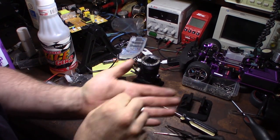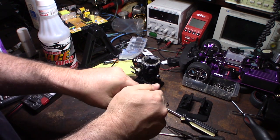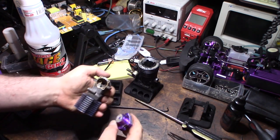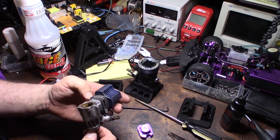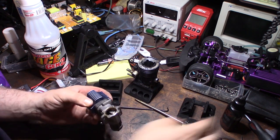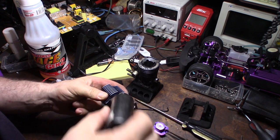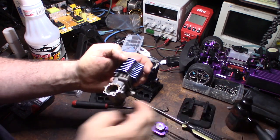That little screw is out — cool. Hopefully nobody meddled with this because it's stripped; this is the first reveal, I don't know what's inside. Instead of whacking it with a hammer, I'm using a little bit of Tri-Flow, going back and forth — and there we go. Rust, but not that bad. Let's get the head off — I'm going to soak a little bit of this Tri-Flow in here to get everything loosened up. I'll come back and let it soak for a bit.